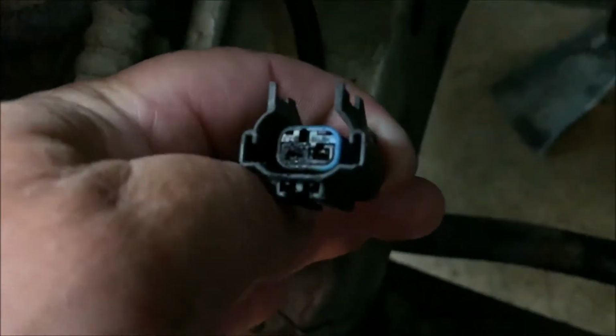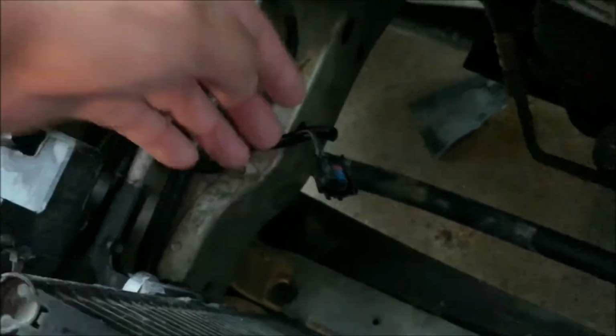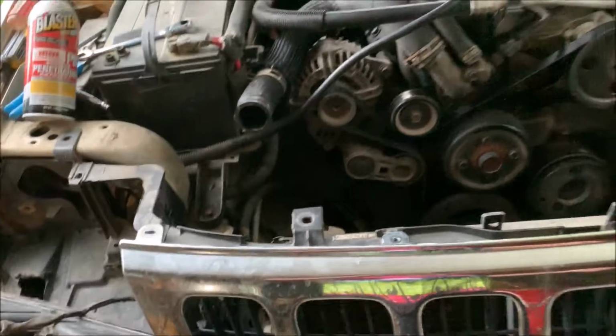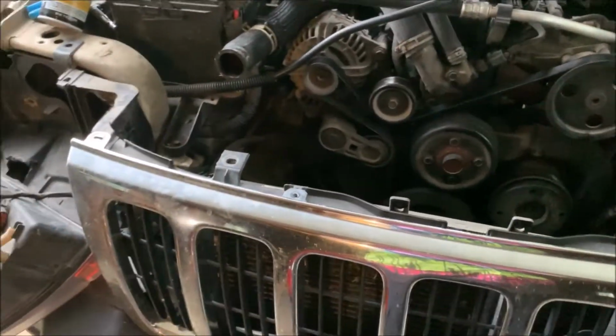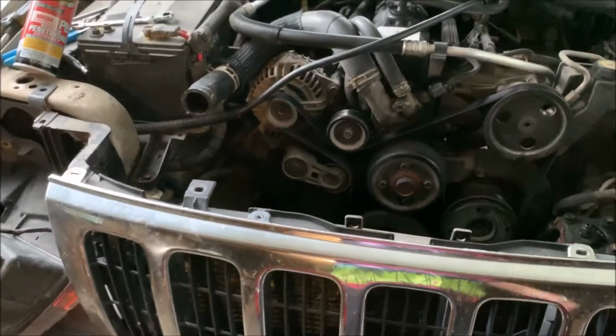The other thing I wanted to show you, see if I can get a picture over here. This plug, see how dark it looks on the left hand side there? I'm a little concerned about that connection. I had a heck of a time getting that plug pulled apart, so I think what I'm going to do is get me another automotive grade plug. I'm going to splice the wires here and get me a new plug put in. I'll have to splice it in on the other motor too, or the new motor I got for the fan. But I don't see any other way around it, because I want to make sure I maintain a good connection there. Without a good connection, could smoke another fan, I suppose.